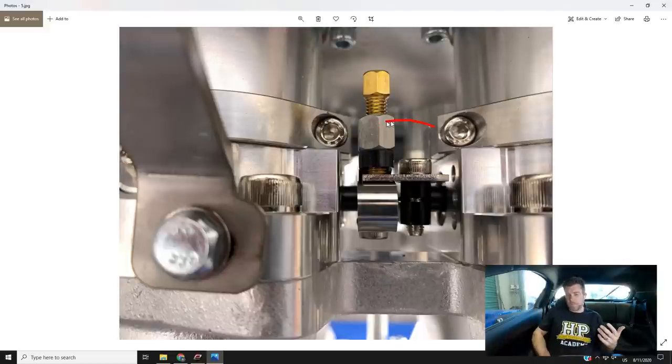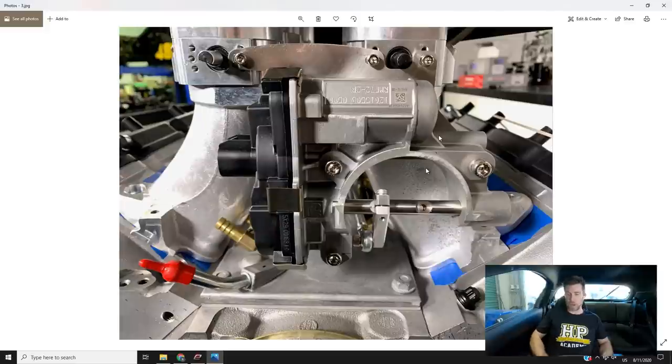One other aspect which is quite novel — I personally haven't seen this before — is the adaptation of a drive-by-wire throttle motor to operate this whole system. It's a conventional single throttle drive-by-wire motor; RHD Engineering have removed the butterfly and made a linkage off that shaft running down to some bell cranks which then operate both sets of throttle bodies. Quite interested to get a chance to see how that all works once we get that engine up and running.